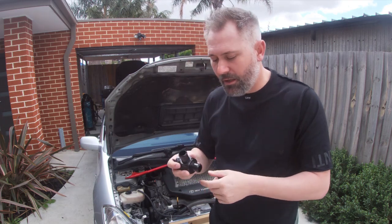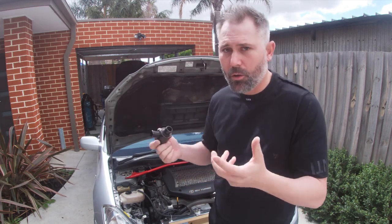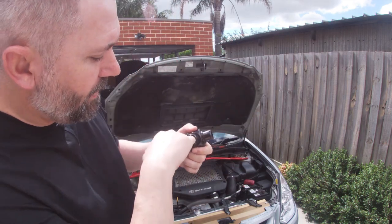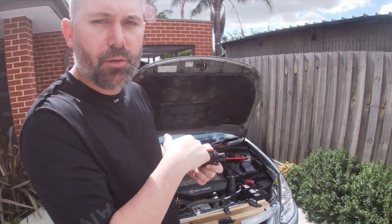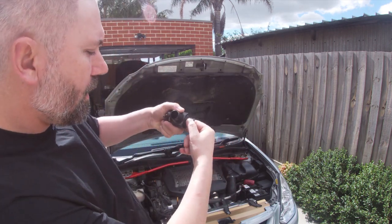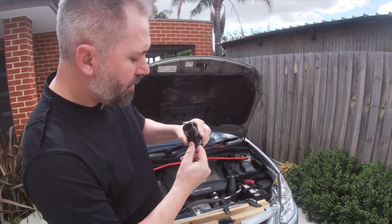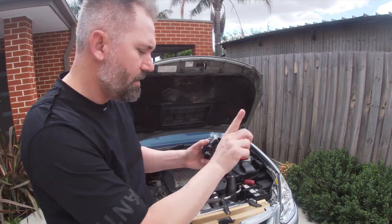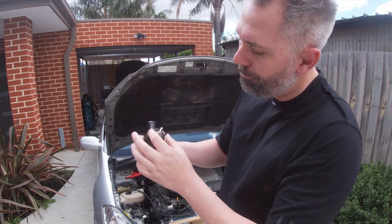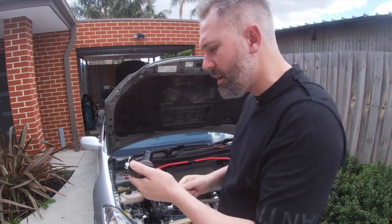Truong's already had a crack at it, and he followed the exact same directions as the factory blow-off valve and put it in what I call, again, backwards. If you put it in backwards on this one, it's going to hit the piston and not do anything. Then when vacuum is applied, it has to open up quite a long way to let that air out. Whereas if it's the other way around, just a slight crack and all the air passes straight through in a nice even flow. We'll put it the way it's supposed to go — it's even got 'plumb back' written on it. That's the way TurboSmart intended it.